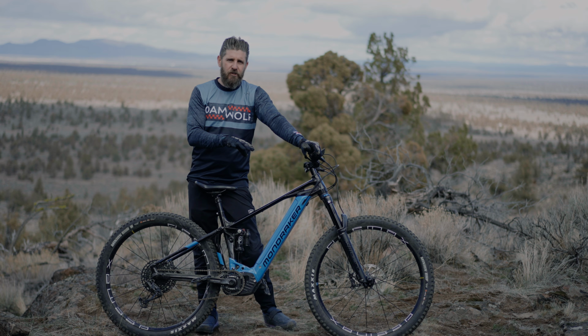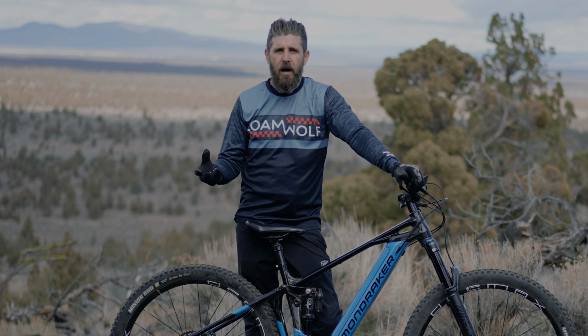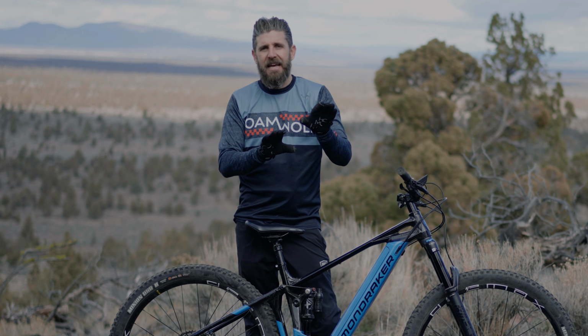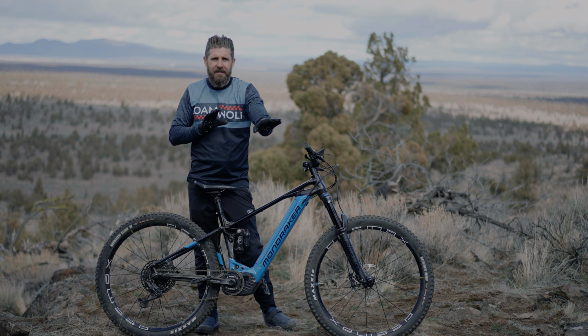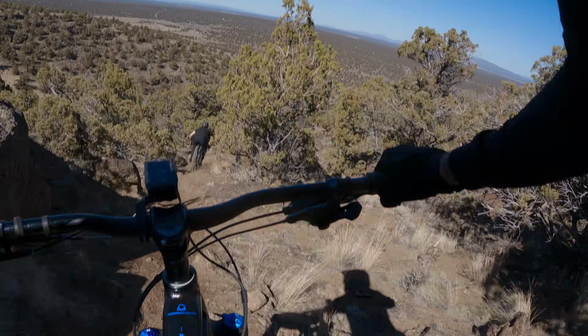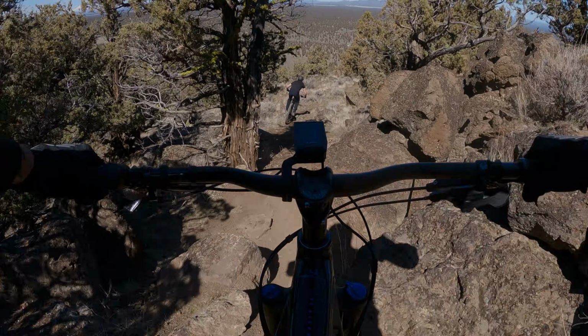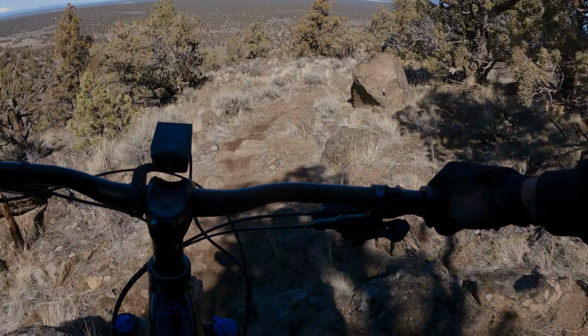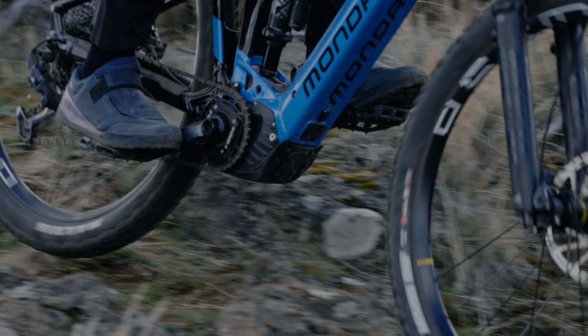Obviously, the downside to having more float, right, if you think about a really inexpensive hub that's got very few points of engagement, you've got that big gap between that engagement when you're wanting to pedal and that free feel. That's kind of what this system is doing, just here at the chainring instead of at the cassette. You get to choose if you want more downhill performance by having more float, or if you want to blend downhill performance with some pedaling and run a smaller elastomer.